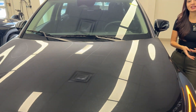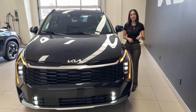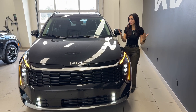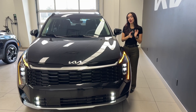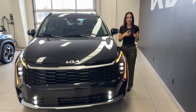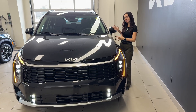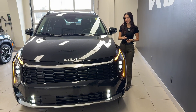The sensor itself is broken up into two main components. Number one is an infrared light. That light is going to beam towards the sensor itself, and if there's no obstruction like water, it's a dry windshield — you don't need any wipers active. Now, if there was moisture, snow, or rain on your windshield, that would scatter the image, and the sensor would pick that up, thus triggering your wipers to come on. From there, we'll show you guys how to make sure the system is functioning, and of course some tips and tricks as well as some minor adjustments.